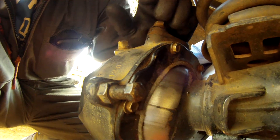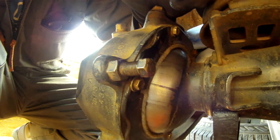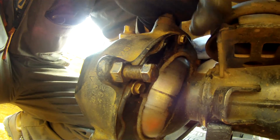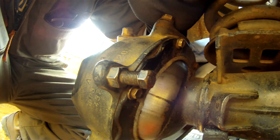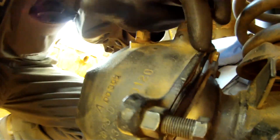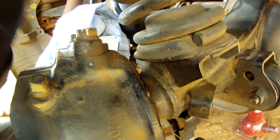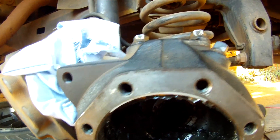The seals here are potentially a lot better — there's not much leakage, maybe because the grease they use is just normal thick grease. These can rust just like on the Land Rover, but they tend not to worry about it much — you just polish it up a bit and put a new seal on. I think I prefer the Land Rover having them separate so you can replace them as they wear. But the benefit here is that the seal is actually split at the top and there are several seals — a felt seal and a rubber seal with retainers — meaning you can put the seal on from the front without taking anything off, which is one of the biggest pains on a Land Rover. So I probably prefer the seal arrangement here, but I prefer being able to change the swivel ball if I need to.